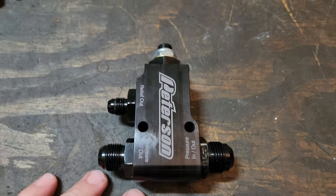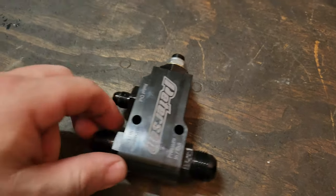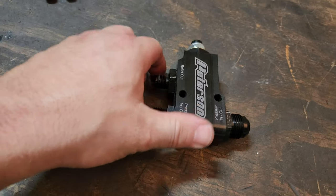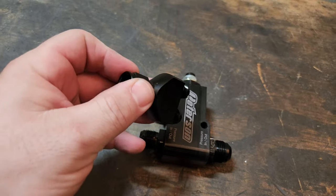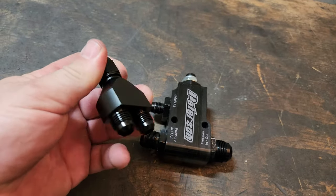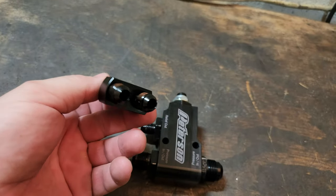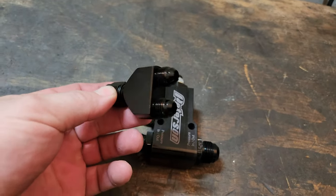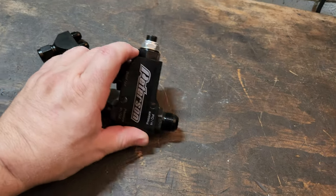I'm going to go right off the oil fill body with this 10 AN right into the body, and then 8 AN, the oil coming in, and then a 6 AN back to a splitter. The splitter is going to be going right into the case. I got a location on there where this will go right in, and I can split the line going back into the case. Type 4 has got an oil fill, and that oil fill location is where I have a return line for my oil system right off of the oil pump. I'm going to tee it and use that right there. Should be good to go, no problem. That'll be the next video, guys.